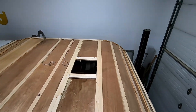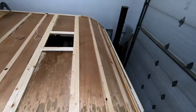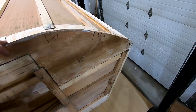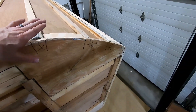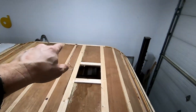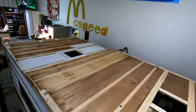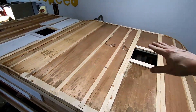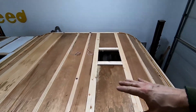We're pretty much ready for insulation and decking. I've made some corrections to this corner — I wasn't real happy with it. I'm still not thrilled but it's better. I took the grinder to make sure that we're level and smooth at each of these control joints. I believe we got rid of all the staples and things that would prevent the material laying down smooth.